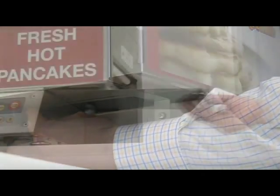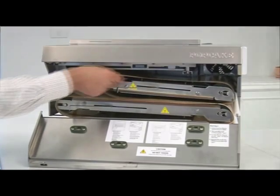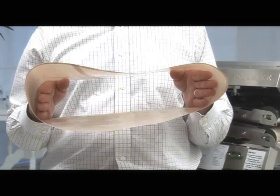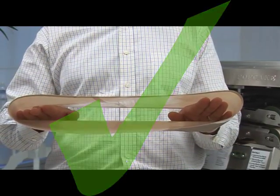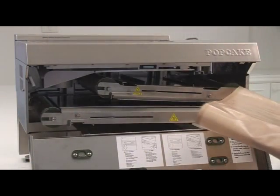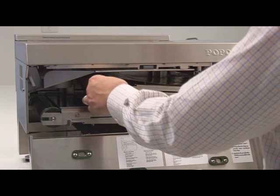Let's see that again. When installing the new belts, lay your hands horizontally flat inside the belt and position the belt slightly over one of the roller drums. This is best achieved by approaching the roller drum at a 45-degree angle and hooking the belt over one roller drum before sliding over the opposite end, as shown.